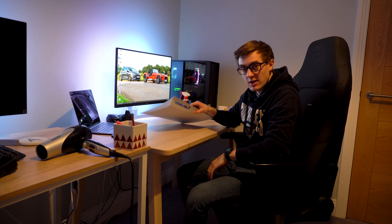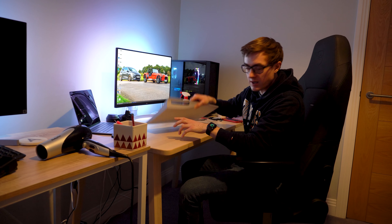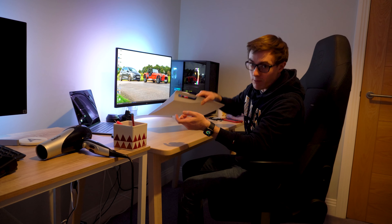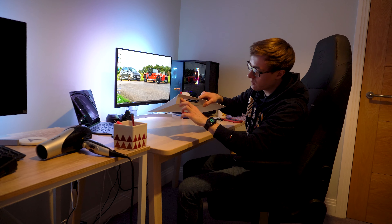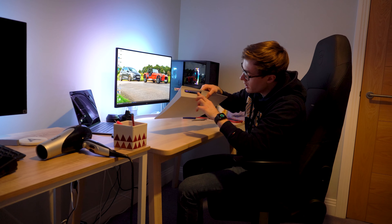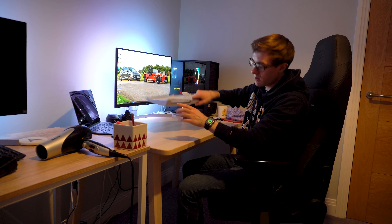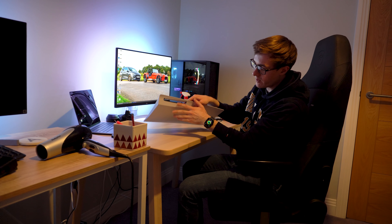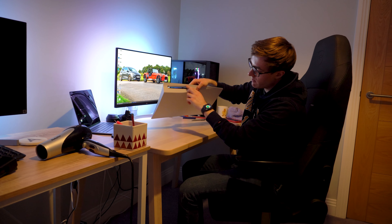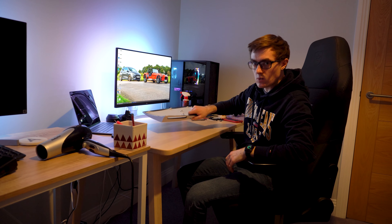On this lower bit I decided to do a bit of an inlay around the disc area. The reason being is when we stretch over the top, I know I wouldn't be able to stretch the wrap inside here, which would mean there would be a little white lip - and I think that would really annoy me. So although that was quite a lot of effort, I think it will be worth it. It's the same principles as over here - when we stretch over it, the covering wrap should go up to the edge and we'll just cut it around there. I sort of cut around here and then fold it in and that should be completely covered then.